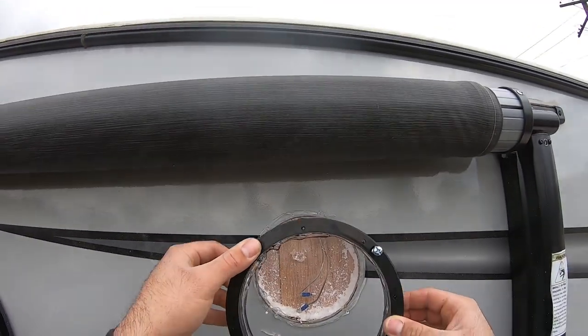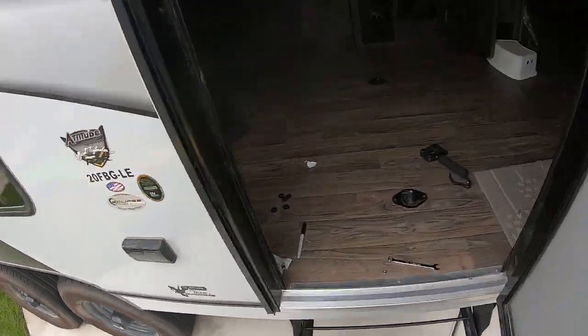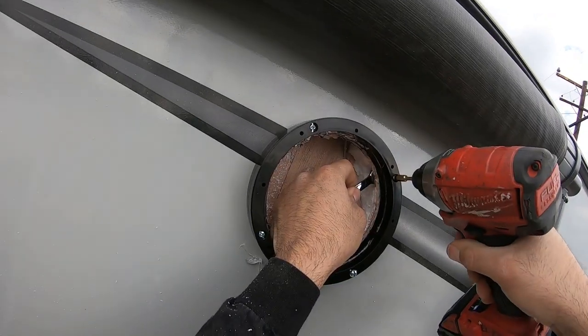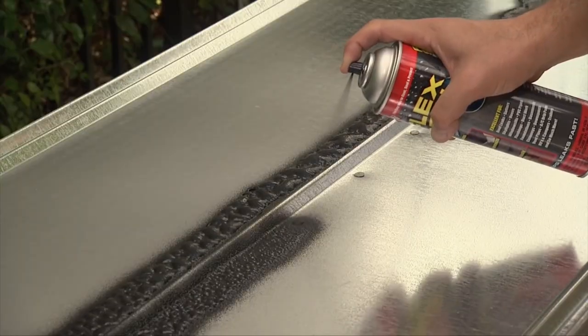Go ahead and get your plate and install it. On the backside after running the screws, we're going to run washers on the backside so it doesn't put too much stress on the wood and fiberglass portion of the toy hauler. Once you bolt up your spacers and let the silicone dry, use some flex seal — this is the secret weapon to keeping this thing watertight and stopping any leaks. We're going to spray some flex seal on the interior cavity. I haven't had any issues with the other speaker; it's been like that for about a month and a half to two months, and we went out twice in the rain here in California. This stuff works, trust me.